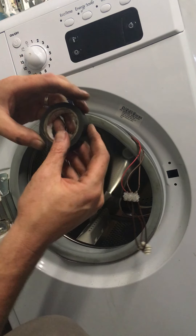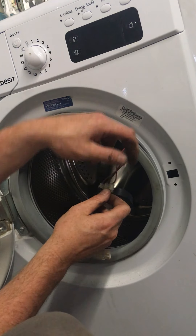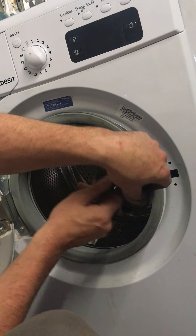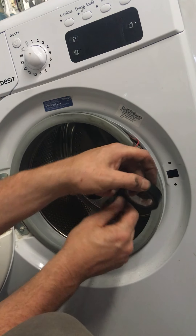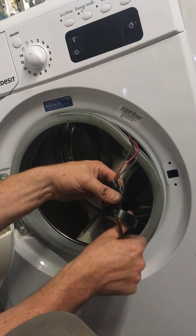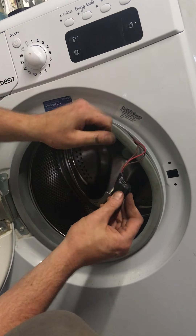So that's the three wires all connected now. I'm going to grab some insulation tape and tape up the electrical block connectors - tape the whole lot up so no wire is exposed. Of course this should ideally be replaced by Hotpoint, Indesit, or Creda, but as I said, people are having zero satisfaction. Whirlpool actually took over Hotpoint, so I think it's Whirlpool's issue now. They're supposed to sort out the issues anyway. That's all taped up.